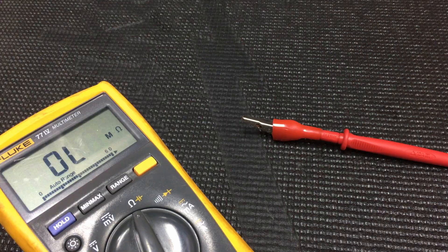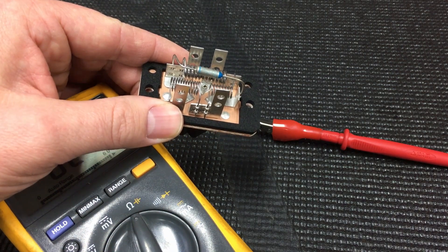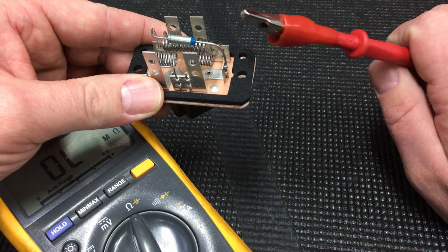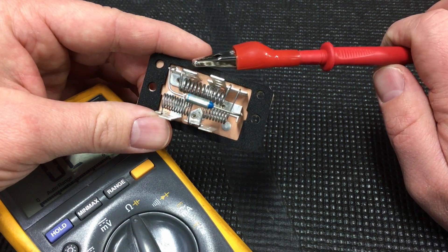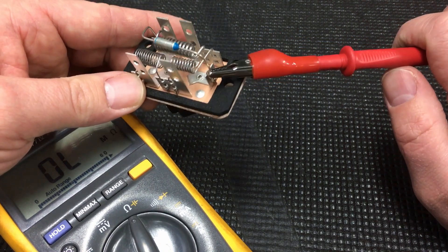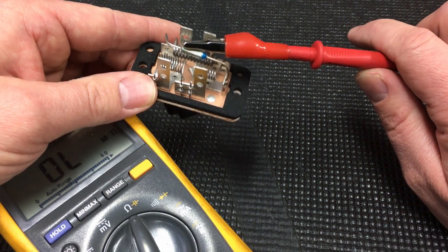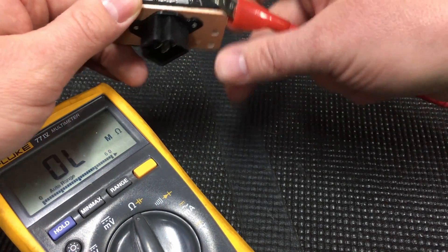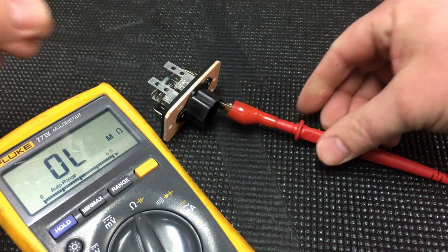The way you diagnose one of these is actually quite simple — you don't even need a wiring diagram. You just look at the backside here and the first thing you do is find the input side. Remember, it's going to be on the side of the thermal fuse that does not attach to a resistor. This side goes right to one of our pins on the bottom — this is our protection device, everything has to pass through here — so that's going to be our ground coming in.